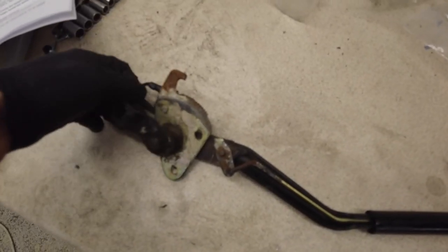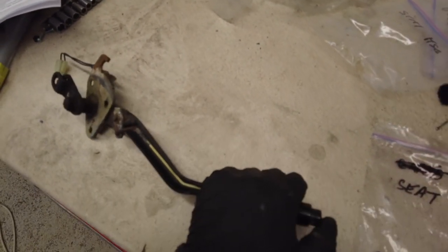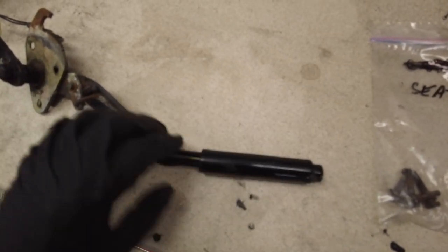You guys probably have a better view than I do, but it's just a big nut and it's finger tight, so let's undo that. That will allow us to take the handbrake cable out of the mechanism. We'll be doing greasing points as well - I just noticed this one has grease points on the drive shafts. It looks like a half-inch or 9/16 spanner - it's gotten a little bit tight so I'm getting a ratchet spanner on it.